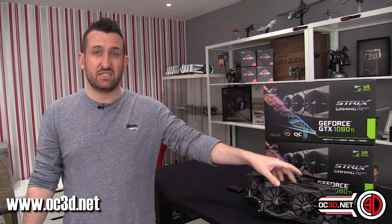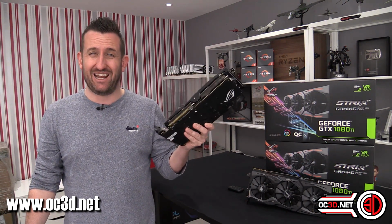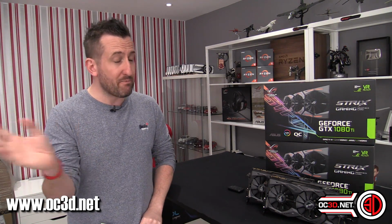So one thing I will say, and I have said it many times, is your power supply is the heart of your system, or maybe the lungs, I don't know. Anyway, it's really important, and if your power supply is of low quality, it can be feeding really bad current and ripple into your kit and basically silently killing it. So that's one of the reasons why we always say try and spend a little bit more money on your power supply. Doesn't matter what brand you go for. I'm not going to be telling you to buy a specific one. Always try and buy one of the better, more well-known brands.